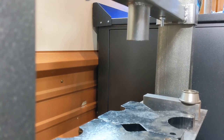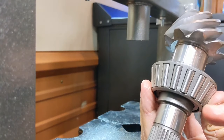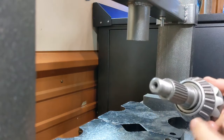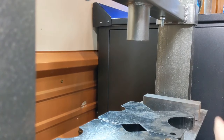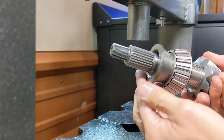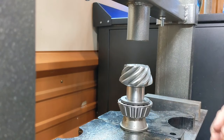The other bearing we have to press on right away is the pinion bearing. We want to make sure we orient this on the pinion head correctly so the race comes up and over. The problem is if you just start pressing, you can see how the cage sticks out further than the cone. So you need to back it up with another cone — you could use the one you cut off. That will allow the bearing to spin without getting damaged.